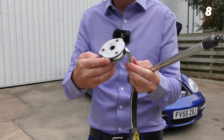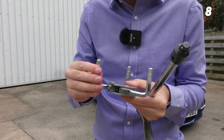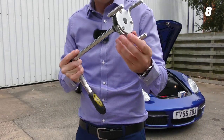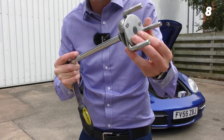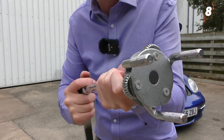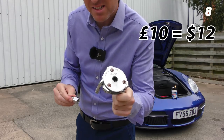Next up you'll need this if you're doing your own services. It's an oil filter removal tool. You get your socket set, plug it in, and put this over your oil filter. As you're turning it, it gradually gets a grip — it's got these gripped ends which grip onto the oil filter and allow you to unscrew it in a very effective way. These are about £10. If you're doing your own services, you need one of these — it'll help you out.